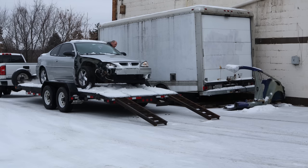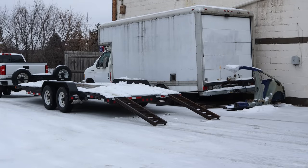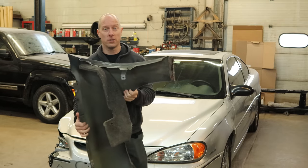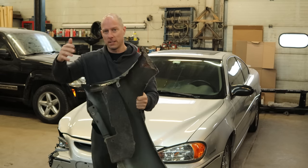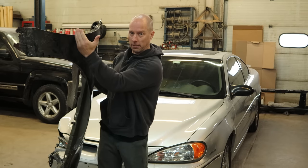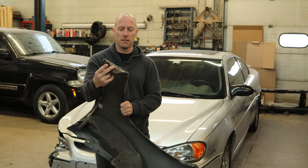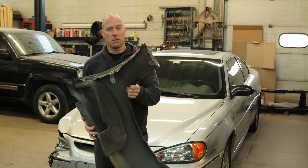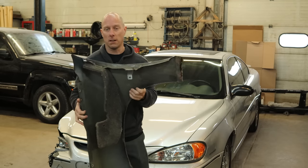It's been a few days and we had a little bit of snow, so now it's time to take the car off the trailer. Scott's Grand Am Emporium had a fender for us, but unfortunately, like all the other fenders in this area, it's been subjected to the salt weight reduction — the end of our fender is missing. Most of them you don't even see it because it's underneath the rocker molding, and this one is no different. So we're just going to cut a piece of metal — it's basically just a flat part with two little slots for the bolts — put it in here, weld it up, and then we'll be able to mount the bottom of our fender.